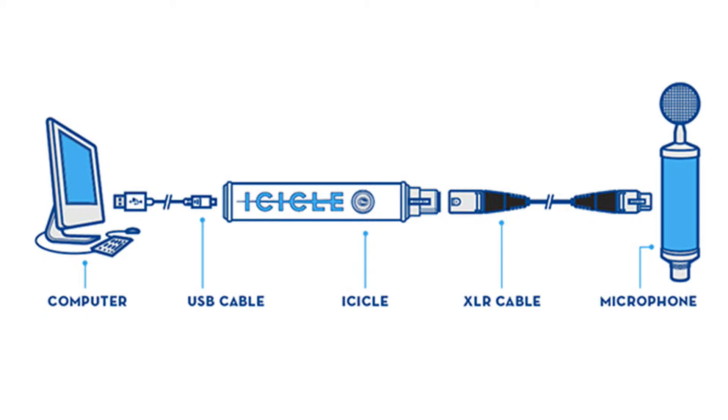Now if you don't want to use USB and want to use XLR, this is probably one of the best things for you to get. It's basically an audio interface but with all the parts you don't need removed — such as instrument inputs, mixing and all that — and just keeping two components: the XLR power and the gain knob that you can turn, which controls your microphone volume. It's really good for people who like to make music in terms of vocals, or YouTubers doing commentaries like I am now, because I'm using it right now.